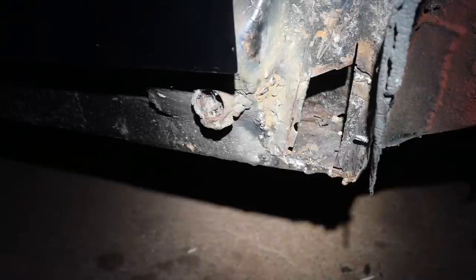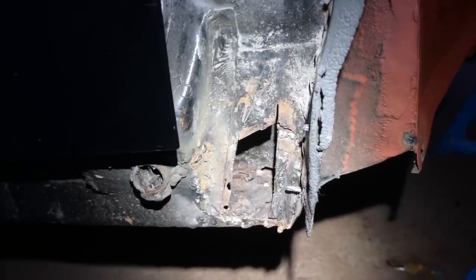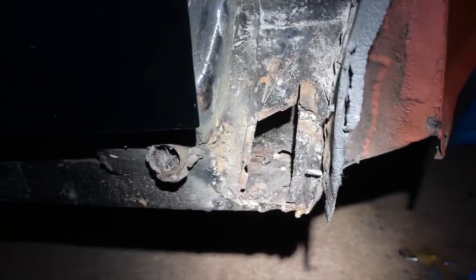Quick sit rep — it's now half past four. That hole in the floor is now buttoned up. It looks almost like there's a dent from the outside into this footwell. I might get a mallet and a big block of wood and just push that down a bit. Filled in a little triangle shape on that corner by the jacking point — I never use a jacking point on a P6 — and just doing this big shape here, to be quickly zipped over and sorted out.